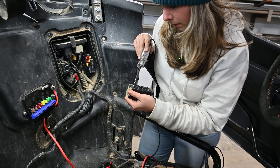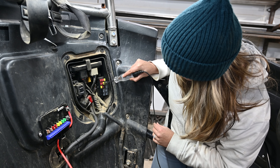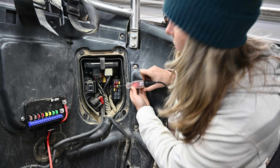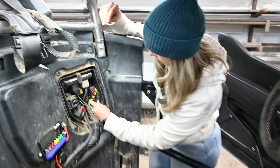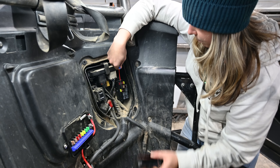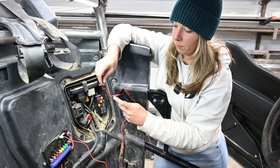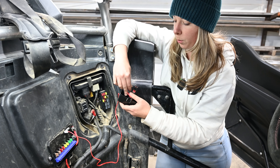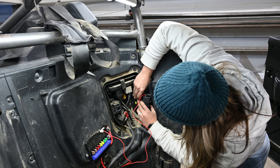We tried the fused lamp fuse — it's off with the key off, and it goes on with the key on, because your headlights. We'll use that one. We test fit the add-a-fuse connector in there and it fits perfectly with no clearance issue. We've got the two wires connected with a butt connector, and Steve drilled a hole in the fuse box cover and put a silicone cap in there to run the wires through to keep the integrity of the fuse box. Now we've closed everything back up.